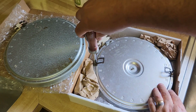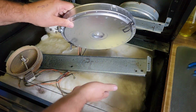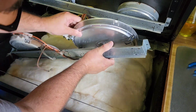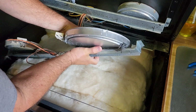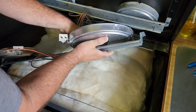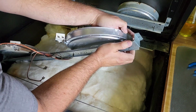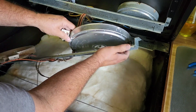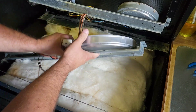And all you got to do is put them right back on that mark that you made on the mounting bracket. Go ahead and put this back on the mounting bracket, right in the marks that you left. They're spring loaded, so when you mount it back up there, it holds them tight. So they're right back in my original marks. And go up and hook the wires up.